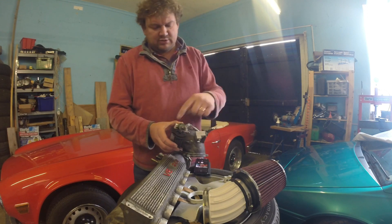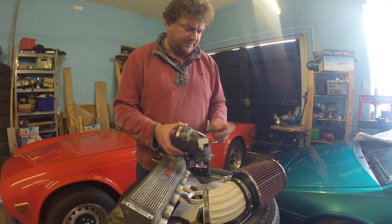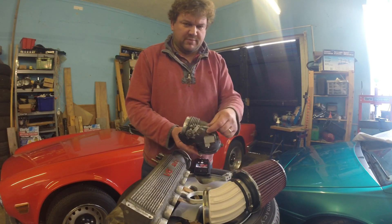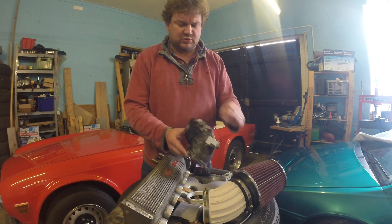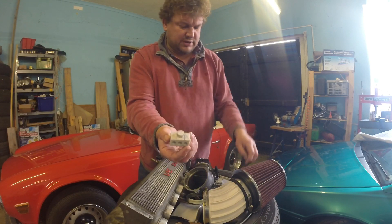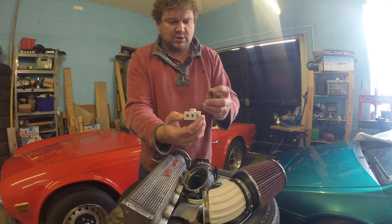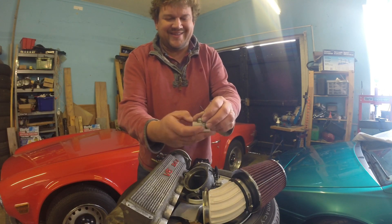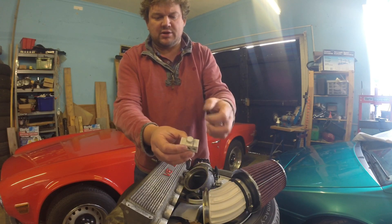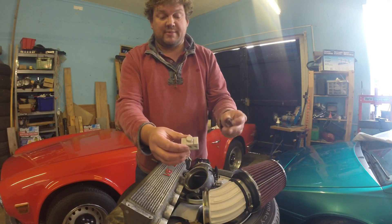I had to modify where the cable goes — there are some special laser-cut bits. I put this spring on because amongst all this I lost the original spring, and what I actually needed was a torsion spring. I lost the original torsion spring, so I 3D printed a block which is a kind of mandrel with a little groove. Basically, you put the wire in there and wind it round, and because I made it with 3D print I could make it any size according to what the spring should look like at the end.